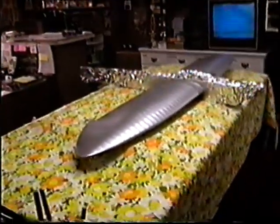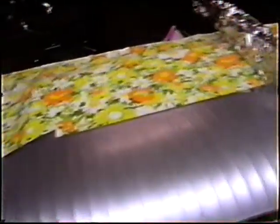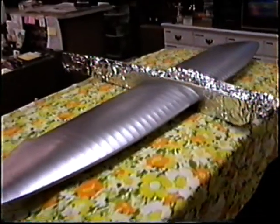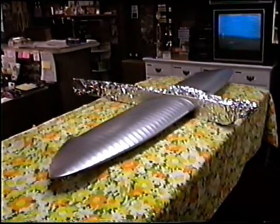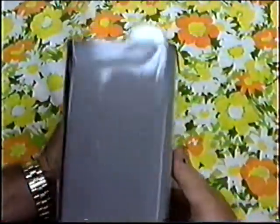Now, what I try to do is always do a little test on the bottom, and in which case, I'll try both methods to see. In this case, you could use 600 or 1200, either one, but you don't want to use anything rougher than 600 to do a silver sand out. This is a body shop product. If you're not familiar with it, it's called Sikkens M600.